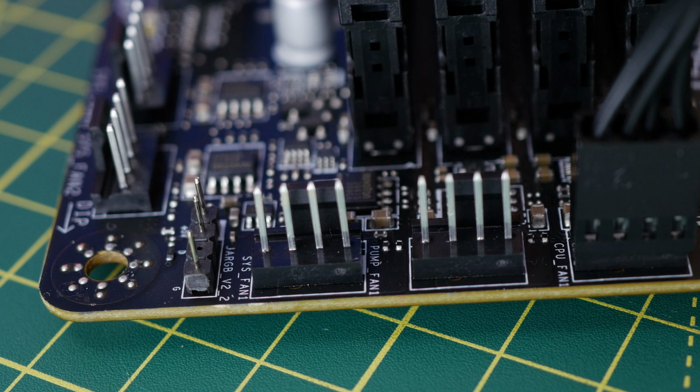And if you're running low on USB connections, because let's say you have other devices in there, not to worry, just get this NZXT USB hub. This takes a single connector and then allows you to connect up 4 USB connections to it. Now it's a powered hub, which means it needs to be separately powered, but you can plug in the NZXT fan controllers, let's say 2 of them if you needed to, and other things, maybe an AIO pump or whatever else you'll plug into it. You can plug all those things in and then just simply connect this to the motherboard and then to your power supply unit, and then that solves that headache.